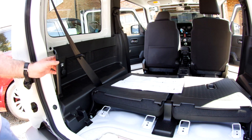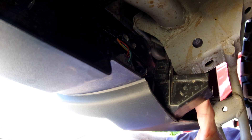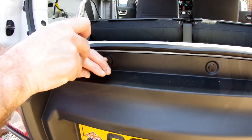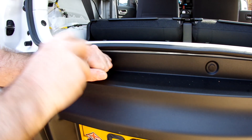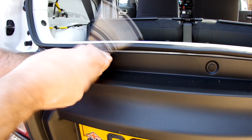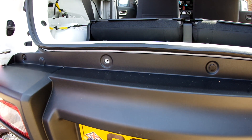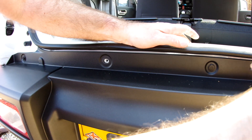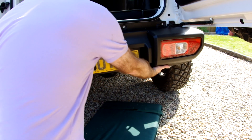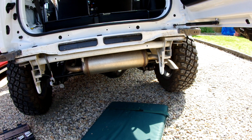Underneath the car at the back we have to disconnect the wiring from the bumper — it's behind a fold-down plastic clip and the little grey connectors are really difficult to pull out. You have to press in the clip. The next stage is to remove the bumper — it's held up by 10mm bolts, plus some of those push-button star plastic trim clips that you pop out with the blade of a screwdriver. You also have to release them around in the wheel arches. The whole bumper then removes — put it somewhere safe so it won't get scratched.